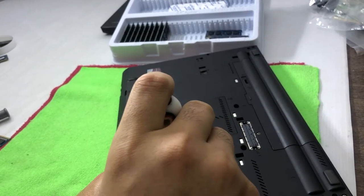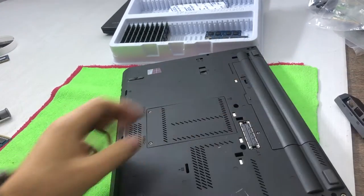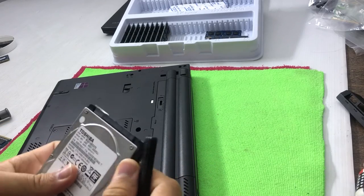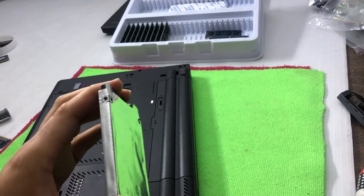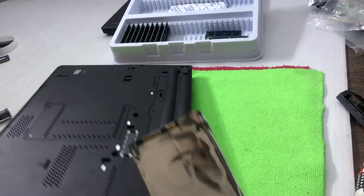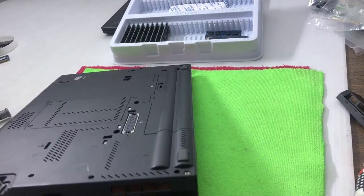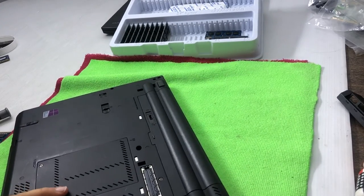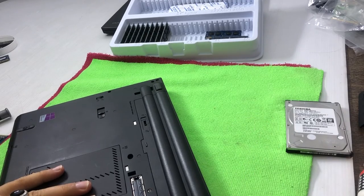Be careful removing the hard drive caddy — don't break the slots. Inside there is rubber padding for the hard drive. If you have a thinner hard drive, put the rubber strips on the sides before inserting. My first hard drive is a bit thicker so I don't need the rubber, but I'll use a slimmer 500GB drive instead to demonstrate properly.